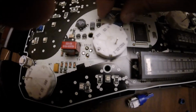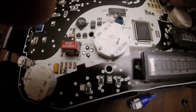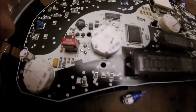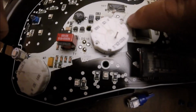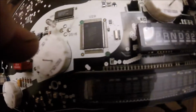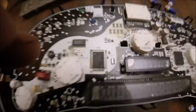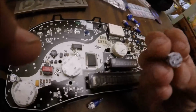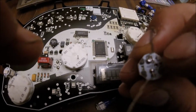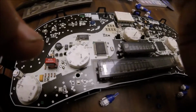So first thing I did was I disconnected one side of each bulb, because I'm going to replace them all. I took out the little blue bases. I plugged it back in and powered it up, and I tested for positive. So you'll see I wrote a little pencil mark. Positive, positive. It's hard to see them, but they're all marked positive. And these are specific to polarity. If you notice on the bottom, it says positive on one side, negative on the other. So of course you want to plug these bad boys in the right polarity.